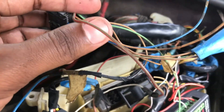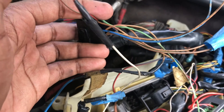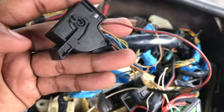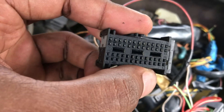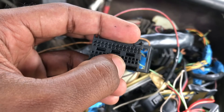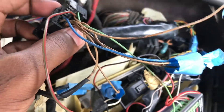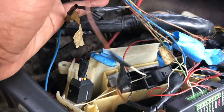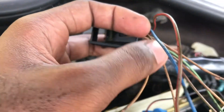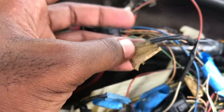I connected a test wire, which is going to my coolant temperature sensor. The second pin I need is pin 35. I went ahead and located and connected that — pin 35 is my ground from the sensor. Here it is, this brown wire. So that's pin 35.